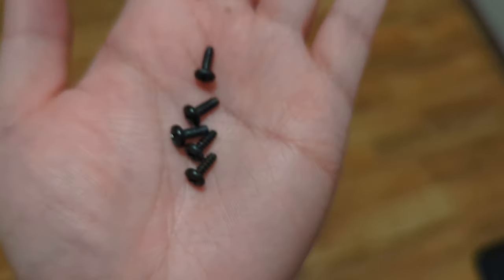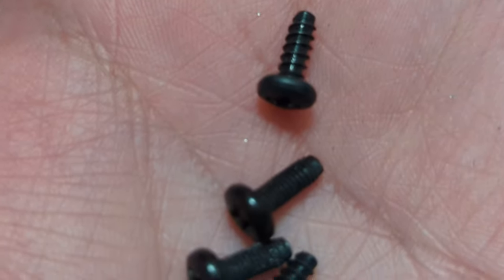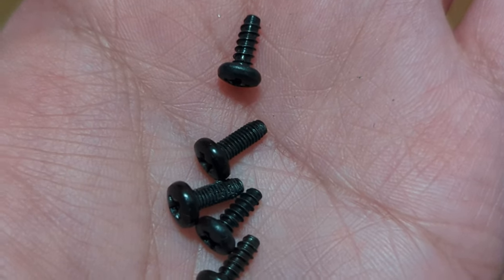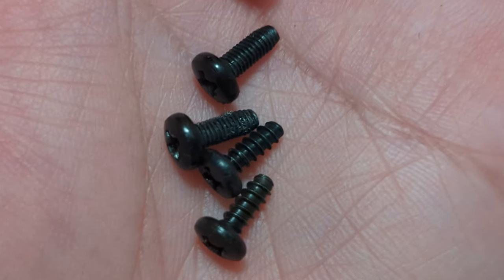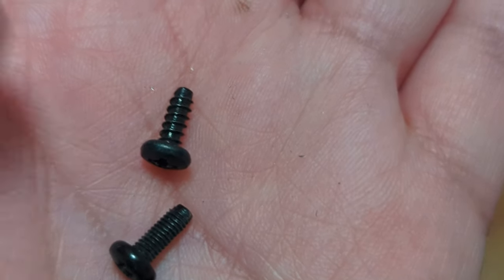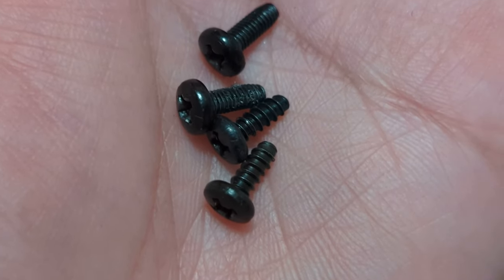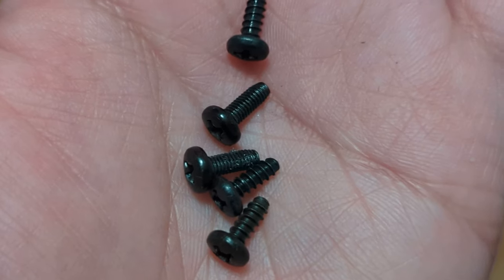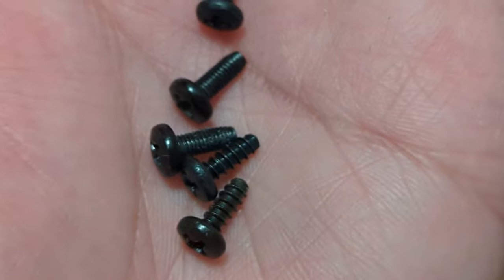Let me see if I can get a better shot with the light. One of the threads on these screws is really stripped, and I think what happened was they used the wrong screw — because if you look at the pitch, it is a lot tighter. That one right there is tight. That was from the back, and this other one that is all mangled up also has a tighter thread. I don't think that's the right screw. The ones with the coarser threads are the ones on the side, and as you notice, there's one, two, and three. So when I took this off, there were supposed to be four on the sides and one in the back. So maybe it's missing screws, and whoever put it in used the wrong threaded screw into the sides, which are supposed to be expecting coarse screws.